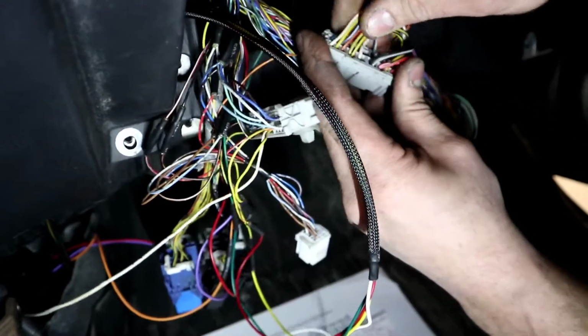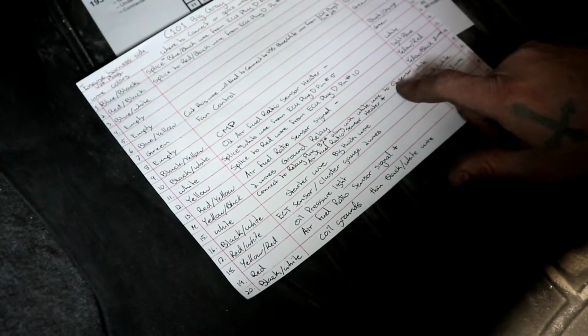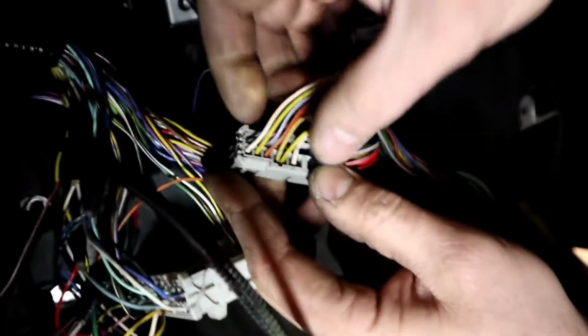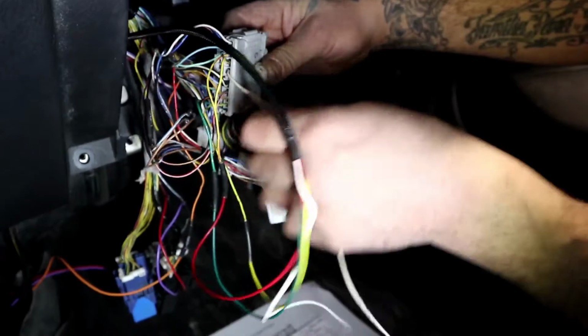Number 15 here on the engine side, what does it say? Number 15, it's a white wire. So connect to relay plug number 87 along with white wire to O2 sensor, air fuel ratio sensor heater plus. Okay, so what is it? We have here a white wire on the engine side, number 15. It's connected. And on our opposite side, we have a white wire. This white wire actually just came loose while we're playing around with all this stuff, and good thing it came loose.